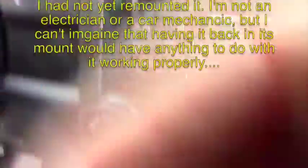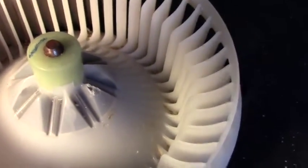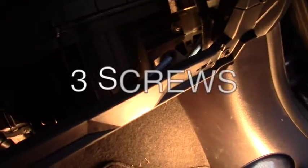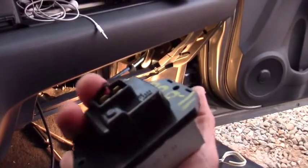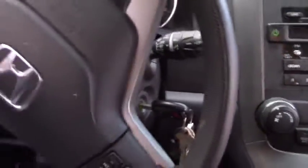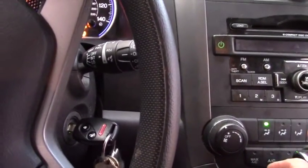So I first took out the transistor resistor, which is way back there — that's operating fine. And now I'm seeing there's dirt in here, which really could be preventing the fan from turning. So we're going to try cleaning that out and see what happens. Okay, so I put the motor blower back in, I've replaced the transistor resistor — which looks like this — cleaned the blower out. And please, these auto gods, let it work. Let's try it.